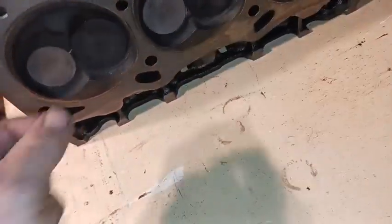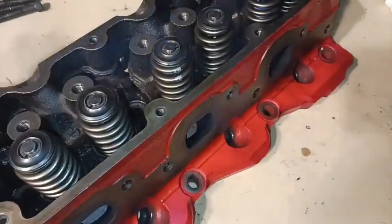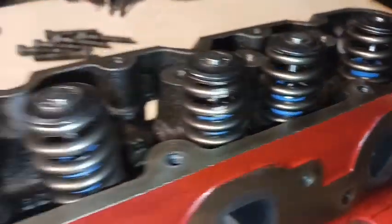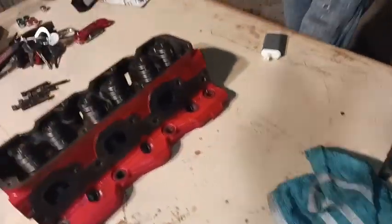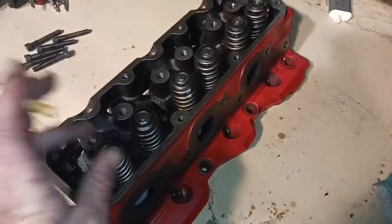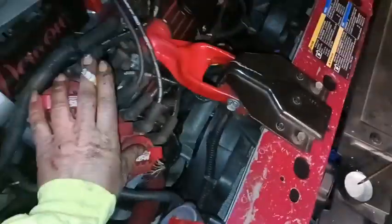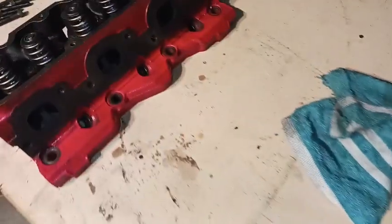Garrett's over here and we've been working on these heads. He got some new valve seals, so these are the old heads off of the '07 — the ones that had all the valve seal exhaust issues. I just pulled all these springs off and replaced all six valve seals. Now I've got to grab the other head. These are the 90-pound valve springs and the LS modified retainers.